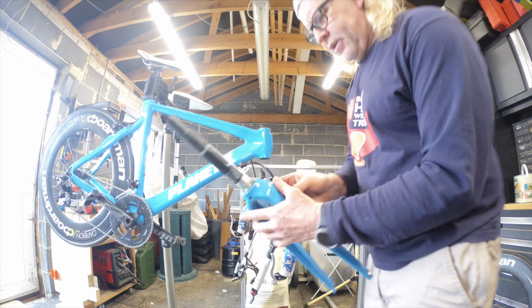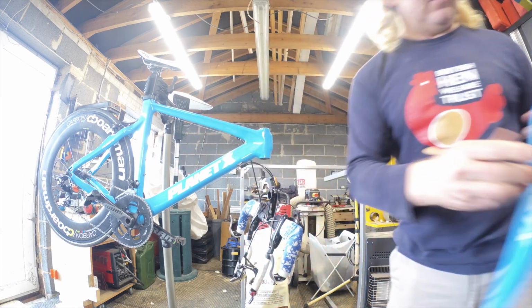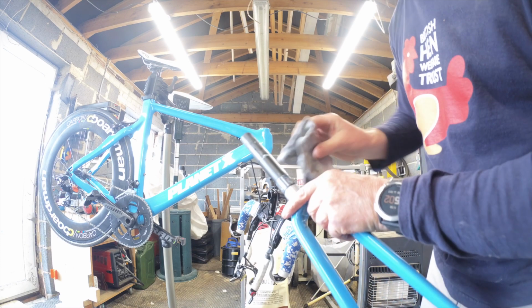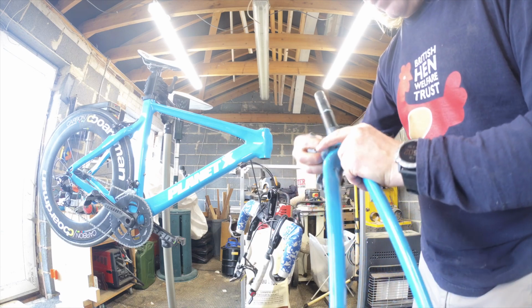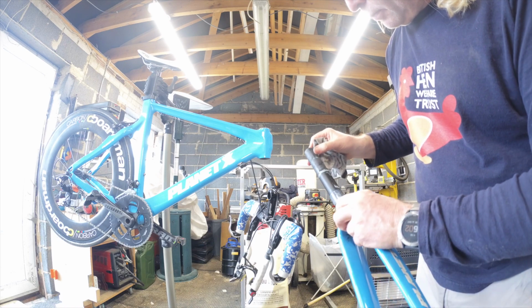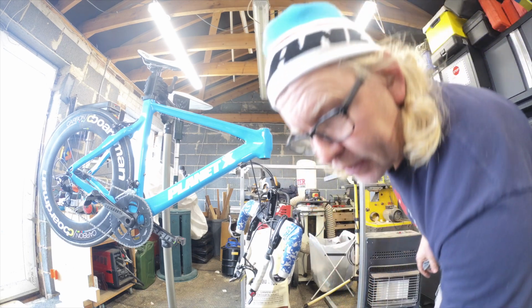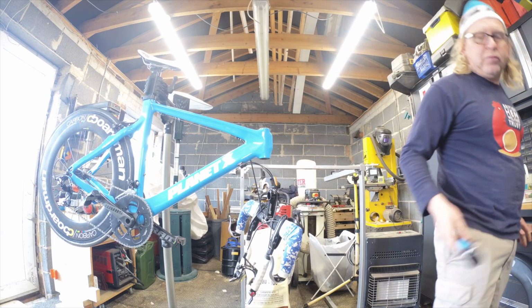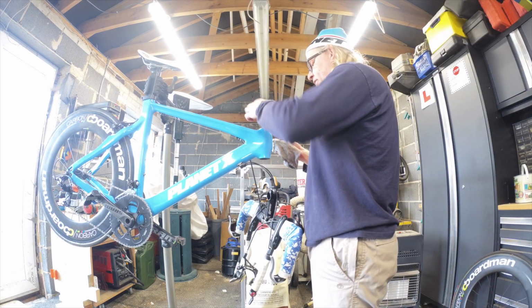And there you go. And there's a carbon fork. Just check it over. We'll just give that a quick wipe round and then we'll re-lube it before we shove it back in. There's nothing wrong with that. That's fine. Seated okay. That's good. Doesn't look like it's got much of the assembly paste left. There's some there. I feel they have used assembly paste, so that's good. That's always a good sign. Like I said, it's Planet X bikes, so they're really decent bikes, and they do build them well. They just seem to have this problem with the headsets that they just always seem to need tightening.